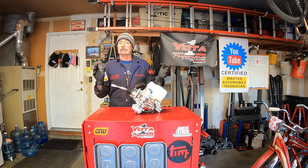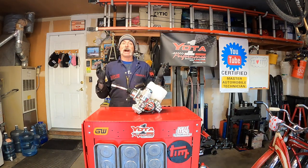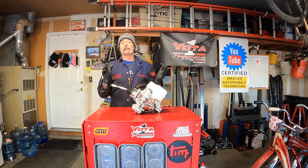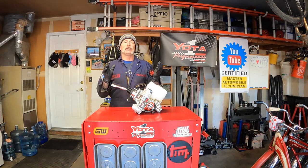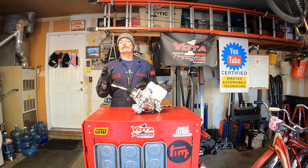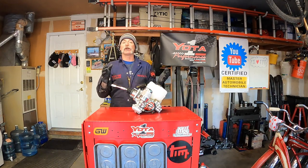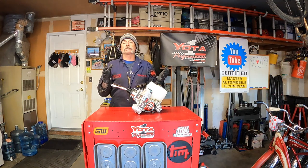They seem to be having hydraulic brake booster problems, and Tan needs a replacement because we tried to get his braking better by bleeding it with the TechStream program — we bled it three separate times — and he still has a bad pedal feel. It sinks really low, he doesn't have strong braking. We just got back from Death Valley and he had some scary braking issues. We've ruled out all the other possibilities — it's the hydraulic brake booster that needs replacing.